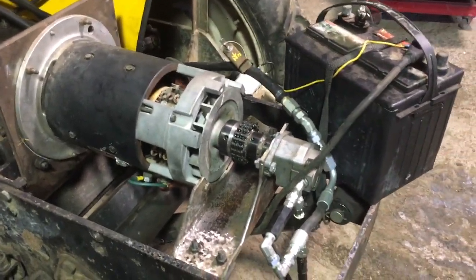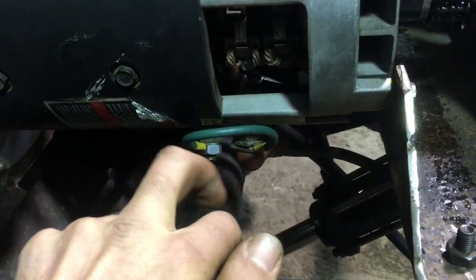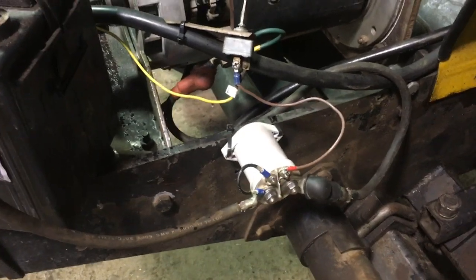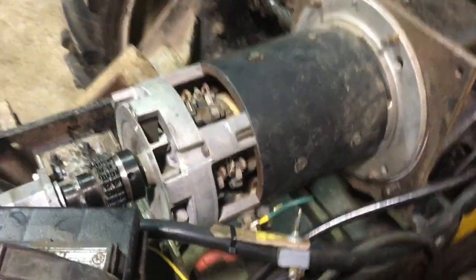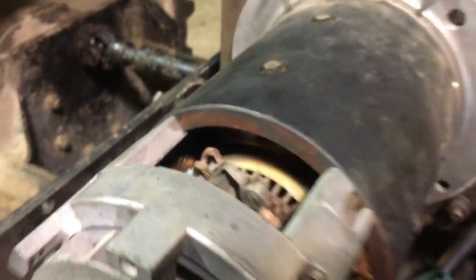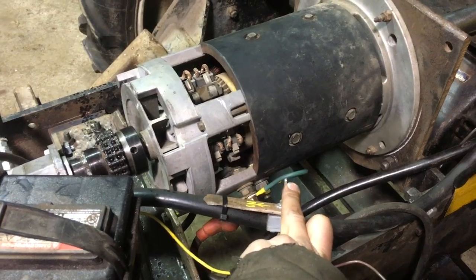For a test run I just plunked a 12-volt battery on it and shunted the field, so this is a small jumper going from the armature stud to the field stud — same thing on the other side. Power, 12 volts, goes to the armature through this contactor here, and this is the on/off switch to energize the contactor and deliver only 12 volts. It's a separately excited motor so the field coils are really small, and for a test setup without a controller, shunt-wiring the field seems to work fine. That was good advice from someone at DIY Electric Car, so thanks for that. And so now if I spin it up...